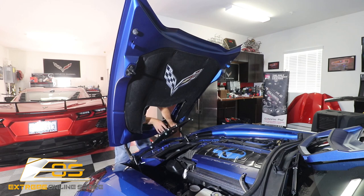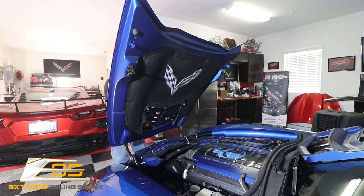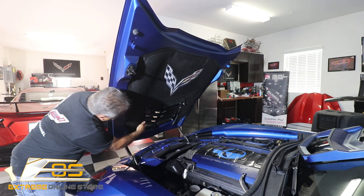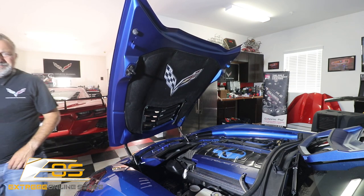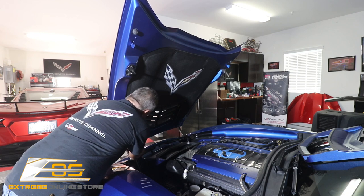Now that we've got all of our clips on the new vent, we're just going to get this up in here and make sure it's cleared so we can get it tucked away underneath the hood liner. Once you've got it in there, push one of the clips up so it holds while you come around. You can take the hood liner completely loose and you wouldn't have to fight it at all, but that's extra work. Pull it all the way up and it locks in place. Then we go ahead and tuck the hood liner back into the hood.